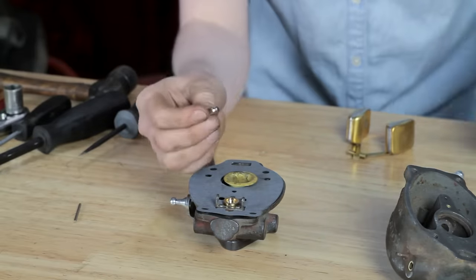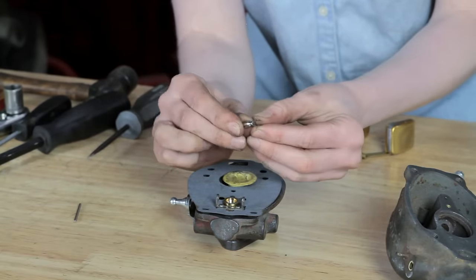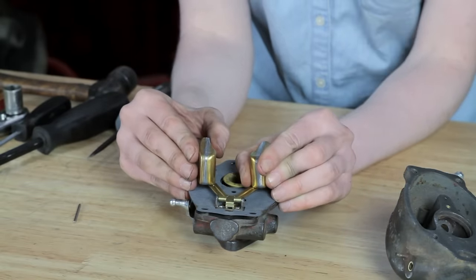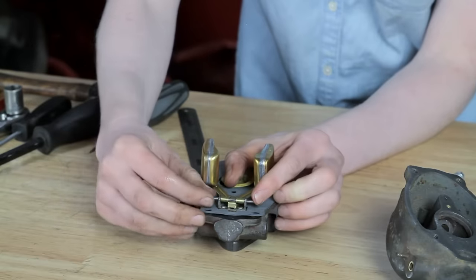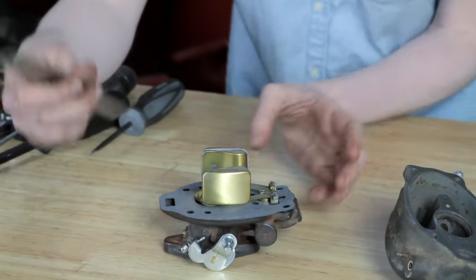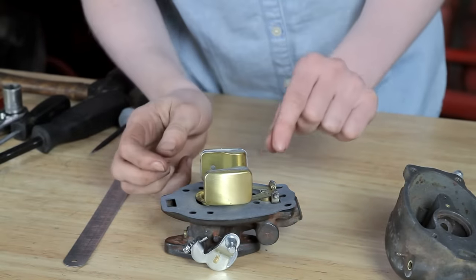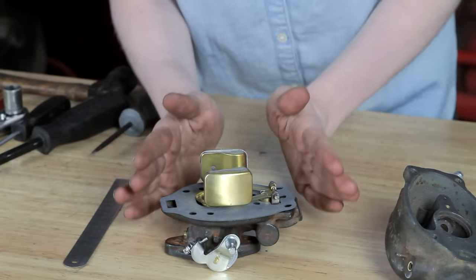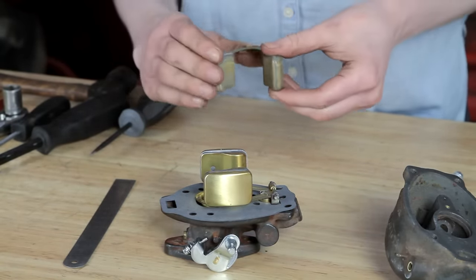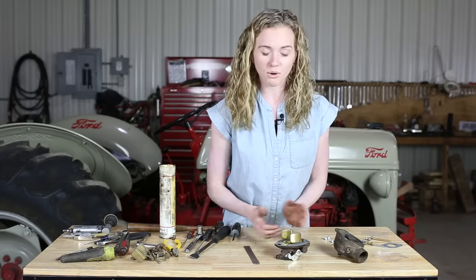Then I'm ready to drop my needle in here. Here's my needle — it has a little clip that goes around the groove right there in the needle. This goes over top of the float, so it just suspends the needle, and I drop it down into the seat. Then I have a float pin that slides all the way across — I'm going to even that gap out. I want to make sure the pontoons on my float are straight across. The directions say to have a quarter inch here and mine's pretty close to right on the money. If you need to bend your pontoons up or down, bend it right here ever so slightly — be careful with your float. I chose to put a brand new float on mine. If your float is dented, corroded, or you hear sediment inside when you shake it, you definitely need to replace it.